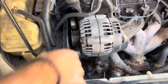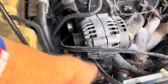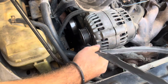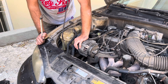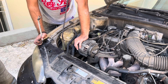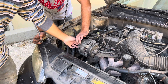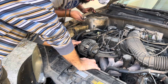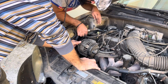Go first on the crankshaft, like so. We routed the belt fully — now just gotta tension the tensioner and slip it on the alternator. You need two human beings for this job: one to press on the tensioner and one to guide the belt to its position.